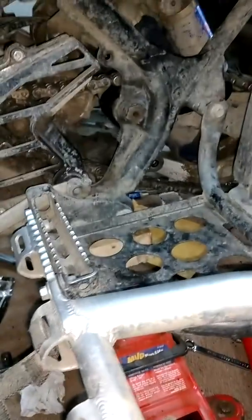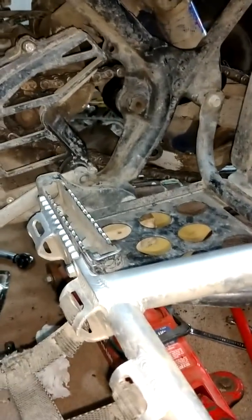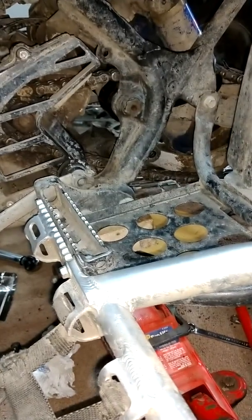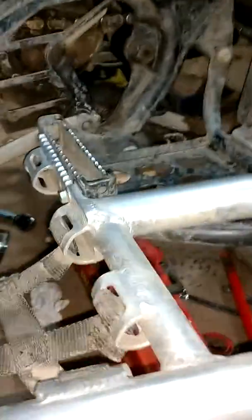Sometimes you look back there and there's no play in the swing arm. Well, maybe somebody tightened it down to the point where the frame is so tight, maybe 100, 150 foot-pounds of torque, and it's holding the swing arm tightly, so you think it's fine because it's got so much pressure on there. But I retorqued everything, and the swing arm's fine.